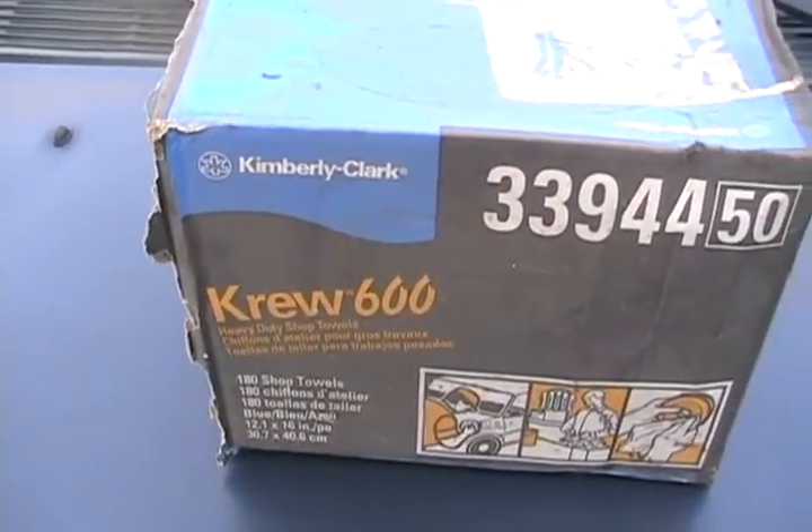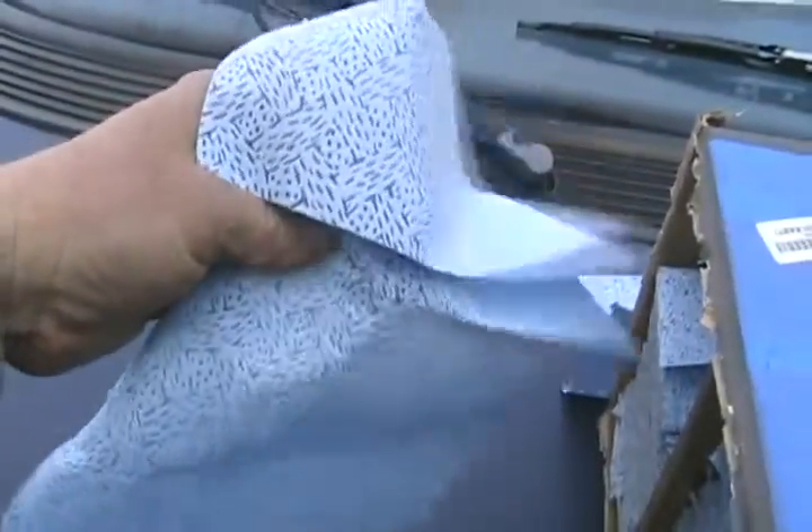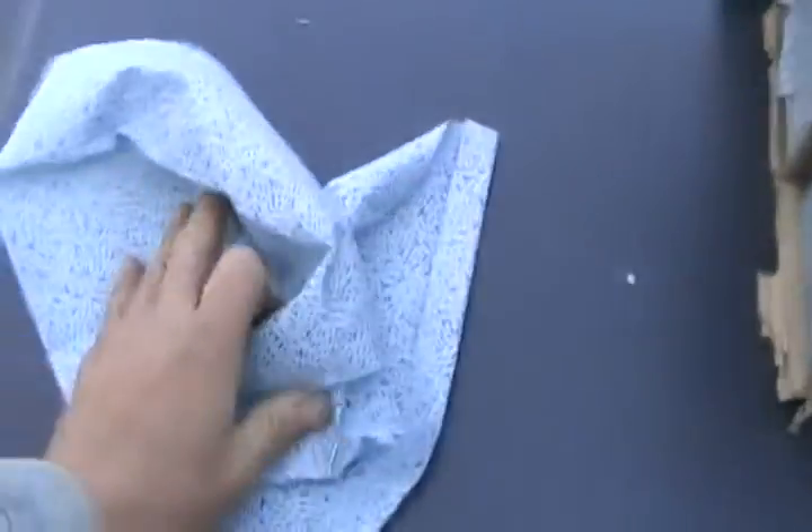Assuming you've got all the masking tape and shiny paper on your car and it's all ready to paint, your final step is rubbing it with a mild solvent — usually called xylene, paint prep, or something like that. If you don't have access to completely uncontaminated clean uncolored rags, you can buy things called kim towels. The color doesn't leach out, they don't create hardly any dust, and they're great for prepping your body by rubbing it with that xylene solvent just before you paint. Don't rub it with that solvent until the last minute.